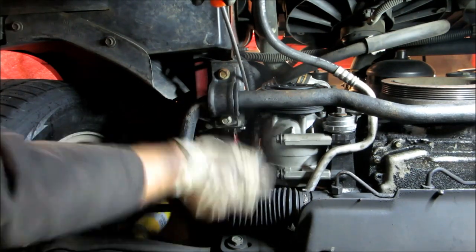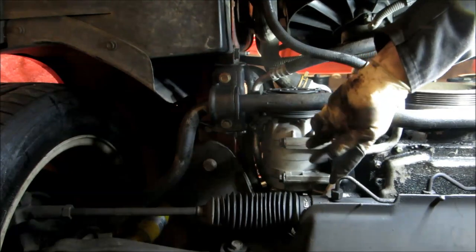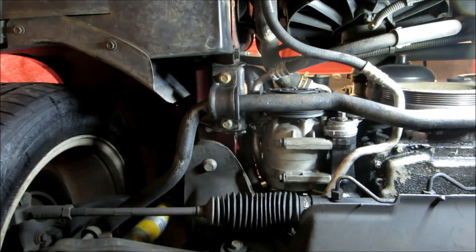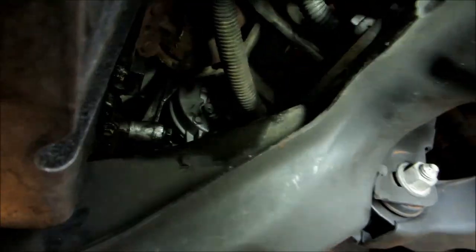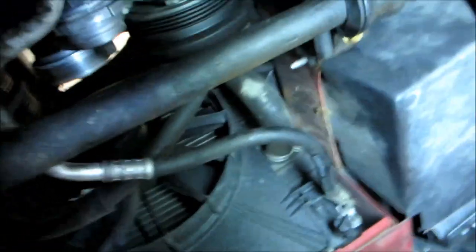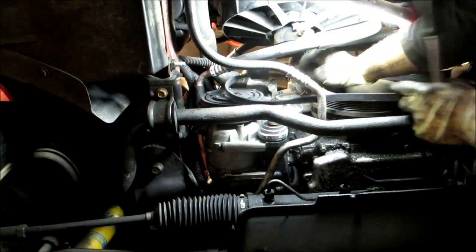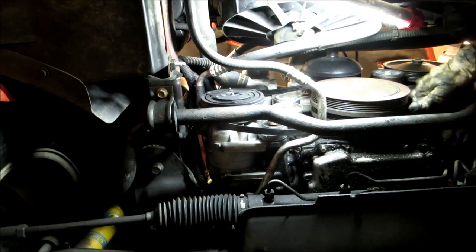Now we can go nice and fast. We've got to hook up the AC lines — I've got to do it through the back underneath this crossmember, reaching up through a hole with my fingers to get the bolt started, using a 13 millimeter wrench. There's the bolt right up through there for the AC compressor; I'm reaching my hand up through this hole and also over the top of the motor mount. Now we've got the AC compressor all bolted up.